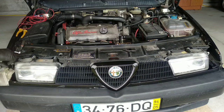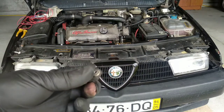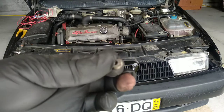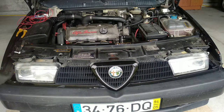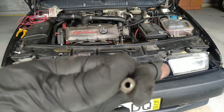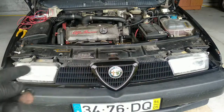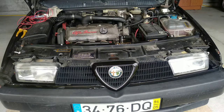Now in this way, the nut and washer is exposed. You take it out with a spanner. The nut is very small — it is 8mm on the outside. I advise you to use a washer, because the footprint of the nut is very small and you will damage the metal here. Use a washer.